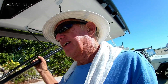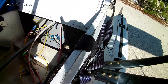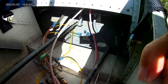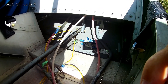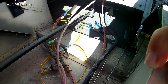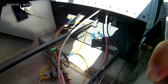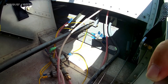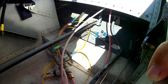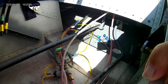So what we're going to do today is all the stainless tubes down in the well here are going to be replaced with the hard rubber tube. I kind of wasted my time building those, but lesson learned. From the pump all the way down into the main gear will be the larger bore tubing so that the fluid will move quickly, and then the nose wheels will just catch up when they do. I don't want to have to pump through these small lines and try to fill everything up with that amount of flow, so that's today's job.